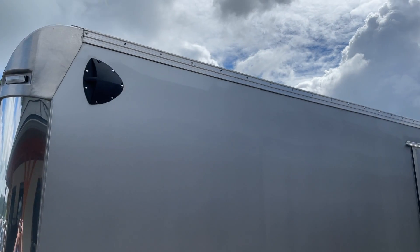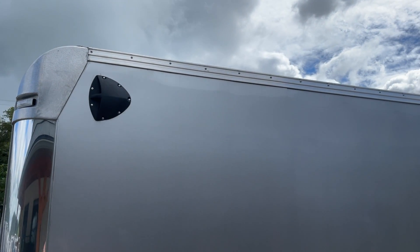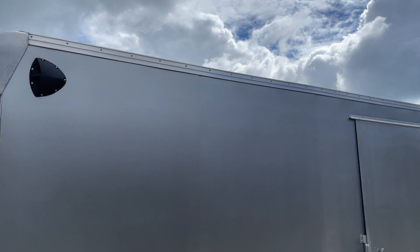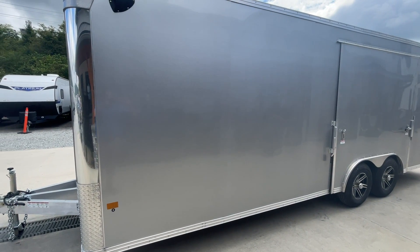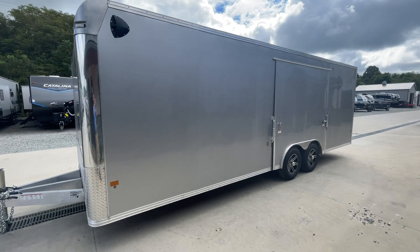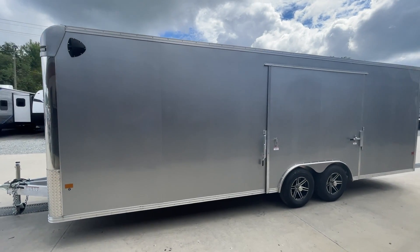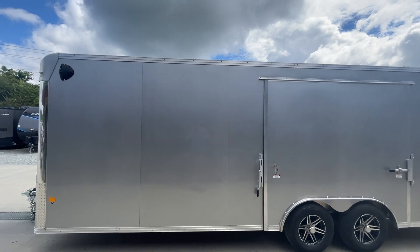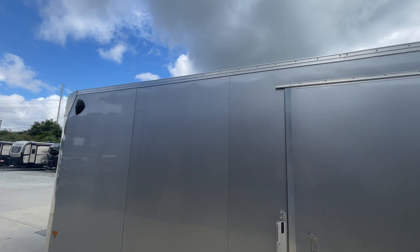It does have a finish cast corner and anodized finish on the verticals. Side flow-through vent is standard for ventilation — it's a nicer looking vent. Notice it's also got a 3-inch top trim, so you've got 3-inch top and bottom. This trailer's got an .030 Silver Frost exterior — notice it's a screwless exterior, with no screws going down the sides of the trailer, giving it a nice clean look. A lot of decal guys like this because it makes for a much cleaner, sharper job even if you don't decal the trailer. Same clean trim look at the top as well.